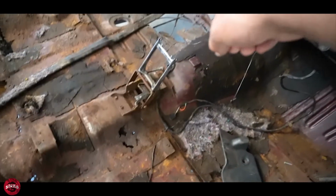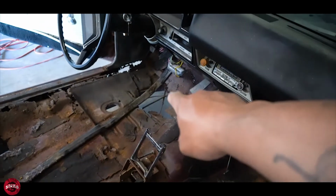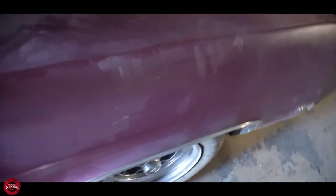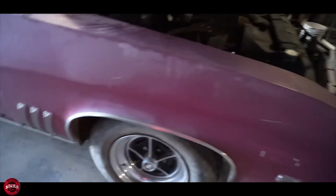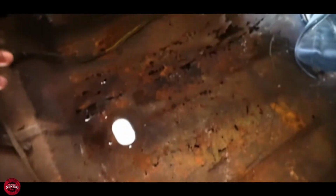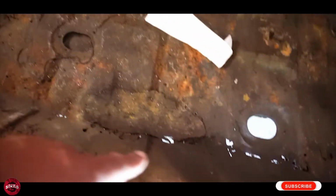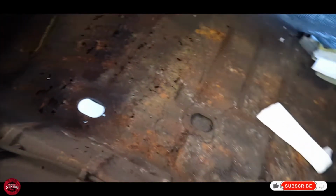Got that floor pan up there in that front corner. We ordered a new one for it right up here to get all that fixed up. We're gonna order the pieces to fix up this A-pillar down in there too. They were back ordered on the two side fenders, so we got the side fenders coming, and we're gonna weld in the sheet metal to fix all this and all the other weld holes down here. We're gonna go in and repair the trunk.